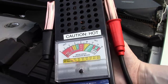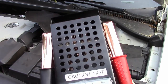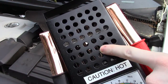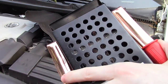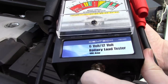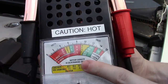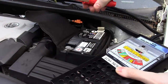To do this you will need a load tester like this. This one came from Harbor Freight and it's a 100-amp load tester. The way this unit works, there's a big carbon filament inside that acts as the resistive load on the battery. It has two heavy-duty cables that go directly to the battery, and this is the toggle switch which will engage that carbon filament to put the load on the battery, and this is the meter that will let us know the condition.